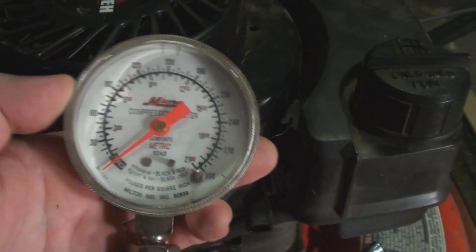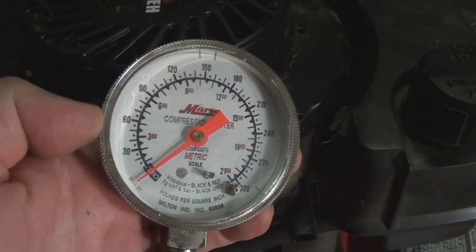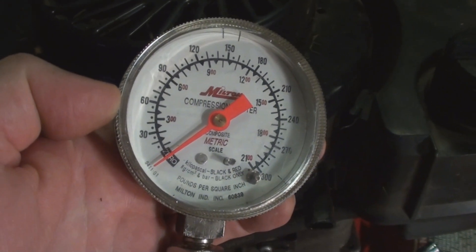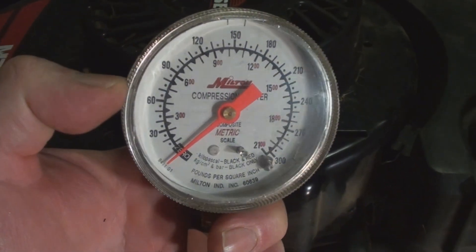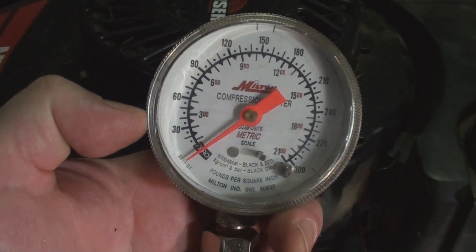60 PSI is generally agreed to be acceptable. 20 PSI is only a quarter of 80 PSI, so that's 25 percent. Most mechanics agree on a range of acceptability of around 15 to 20 percent, so 25 percent is quite generous. Keep in mind it depends on the type of machine — consensus seems to be it will still cut grass acceptably under normal conditions even with a 25 percent loss in compression.